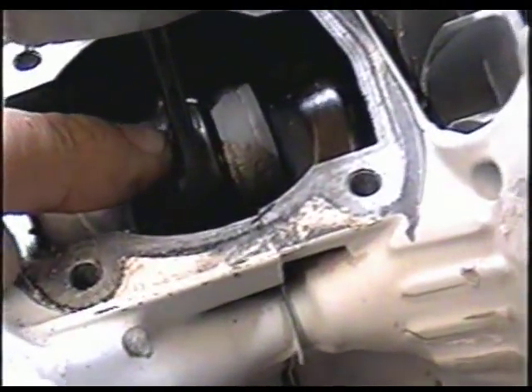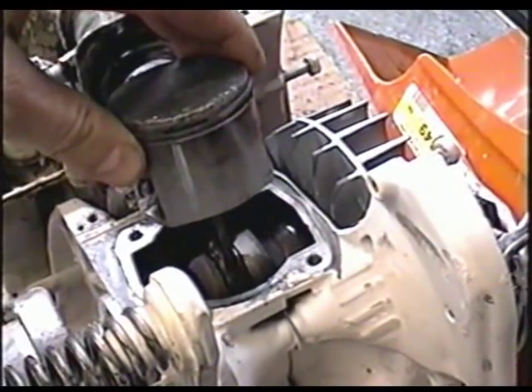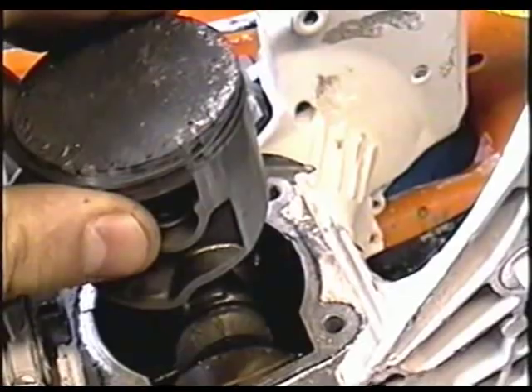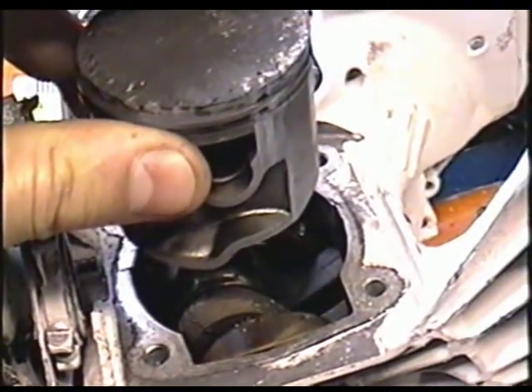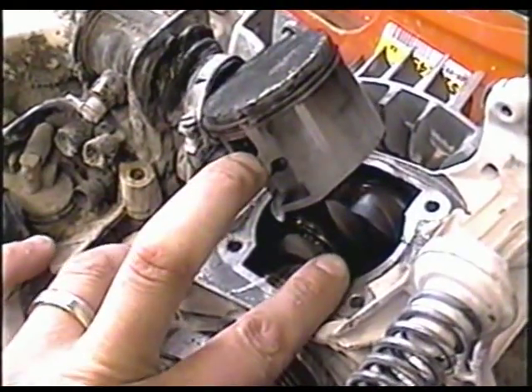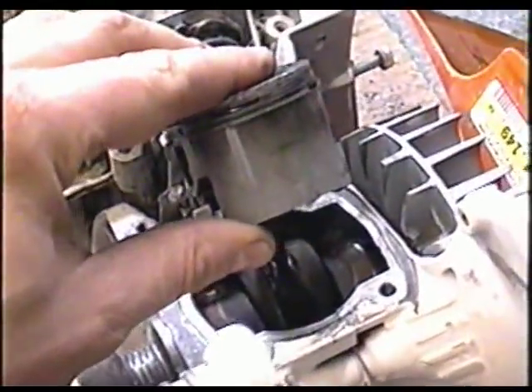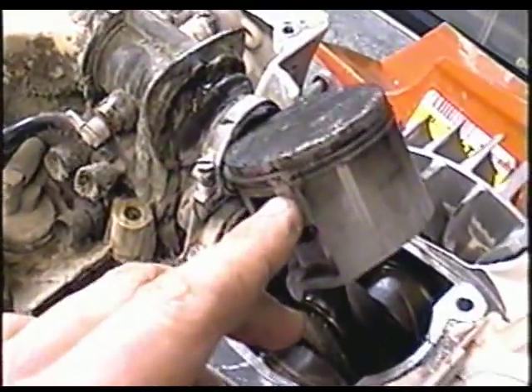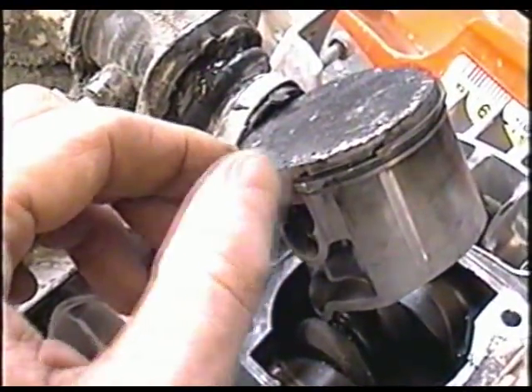Some YouTubers were asking me if you can buy just the sleeve for the cylinder. Well unfortunately you can't — on snowmobiles you can do that, but on equipment with small engines like this I've never been able to buy one. So I'm not going to bother refacing or honing it because the scratch is way too deep. Also I've noticed there's a bit of looseness where the connecting rod goes on the crankshaft. If I move the piston and the rod sideways like this you can see the slack in there. There's no slack if I try to move it up and down, but there is a bit of play in the piston wrist pin and the little bearing on the connecting rod that holds the piston. So that's two places on the engine that have wear and tear. If you rebuild the engine without replacing the crankshaft and the connecting rod, the piston may tend to move from side to side, and this could be exactly why the ring broke — it'll tend to rub too hard on one side.